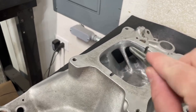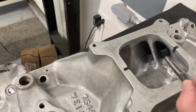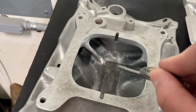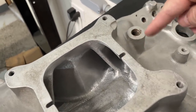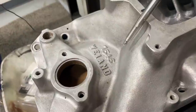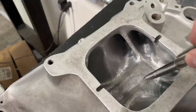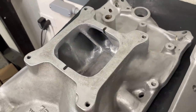With the bad approach angle, you're never going to see the valve — at best you can see further into the port than with the worst ones, but you're still just seeing a wall. What made this Weiand manifold a bit unique is the plenum design — they actually moved it back, which on high-end manifolds we do: I put an angle going this way because it straightens the runner. This manifold is also unique because there's a metal plate shoved through it to convert it from a single plane to a dual plane. Hot Rod magazine tested that, and I don't think it did very well.